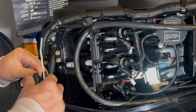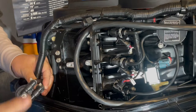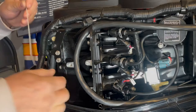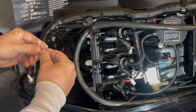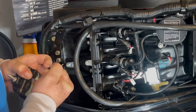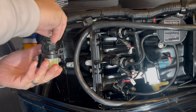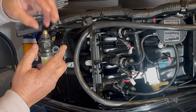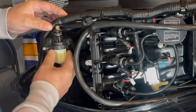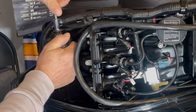We're going to push this corrugated tubing back up. This zip tie — I want to get that up right there. The zip tie is basically on the cut side of that corrugated tubing. Now I'm going to put another zip tie to cinch down the corrugated tubing back down onto the fuel line itself. This is a very amateur thing — I would not be afraid to do this. Got your washer, got your nut. It's basically for vibration — it's a washer that pinches into this bracket here. And you're done. I am going to tighten this nut back up, and that's it. That's all you got to do.